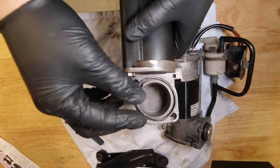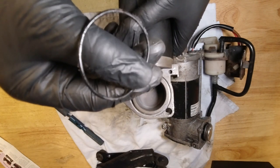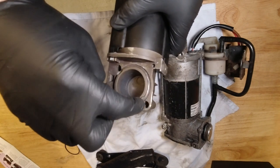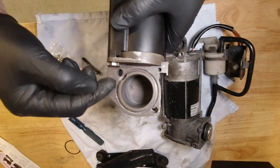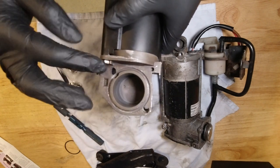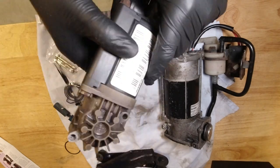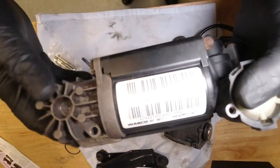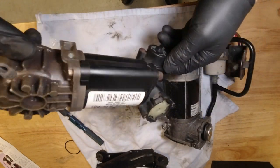It's got this ring on. I've obviously popped it just back on for effect. It's an O-ring. That is going to be disposed of, and I've cleaned out the groove with a little bit of wire wool and cleaned up this surface with the back of my stainless steel bit of cutlery and cleaned it off with alcohol, and it's all nice and smooth. This bit is a dryer. It just basically contains some granules of drying agent. I haven't got a new one, so I'm not going to disturb it.